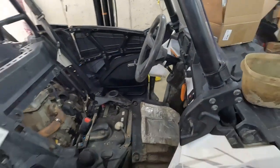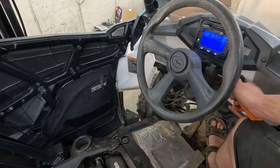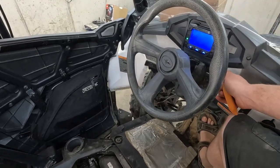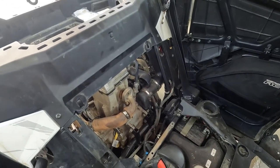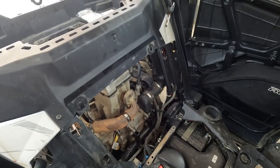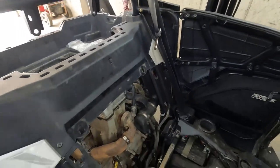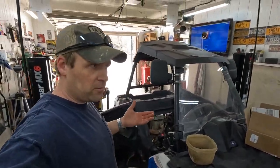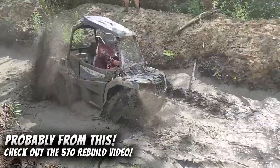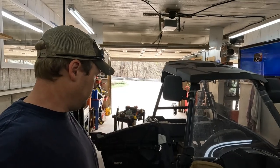The tolerances felt a little better. This thing's been sitting for no less than a week, so this is a cold start — let's see what we got. That was better! Tight intake valves — who would have thought the intake valves worked themselves so that the tolerances were too low and it wouldn't start. Ran fine but would not start on cold days. That's about as cold as it gets right now — it is 70 degrees outside — but still, it wouldn't have started before. So that's pretty cool.